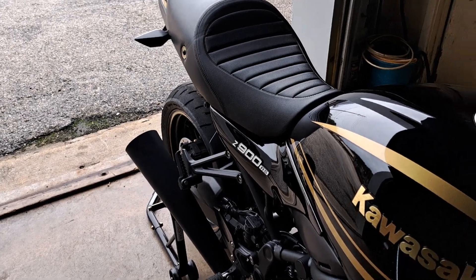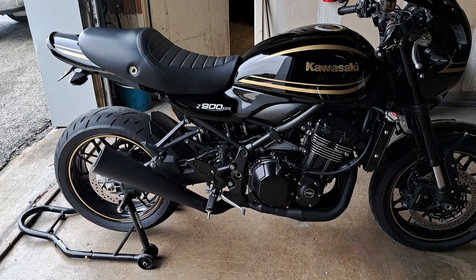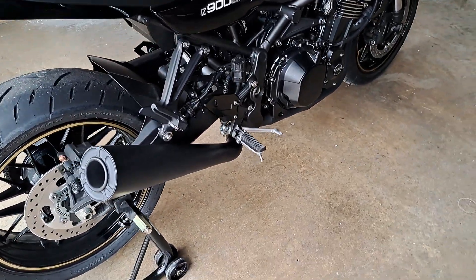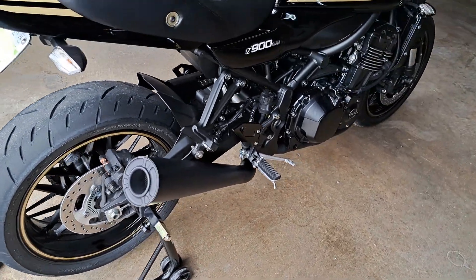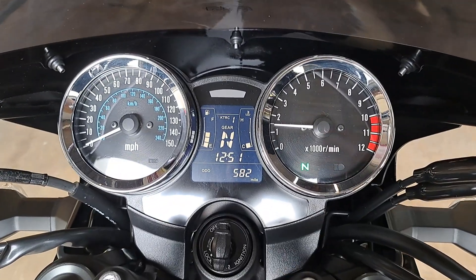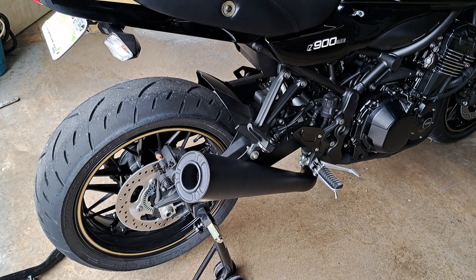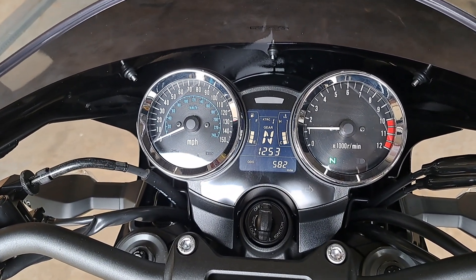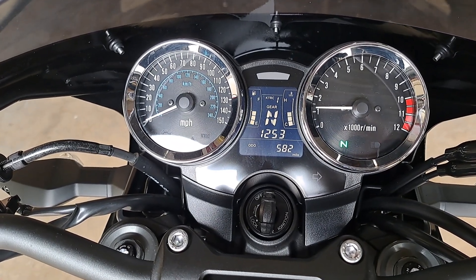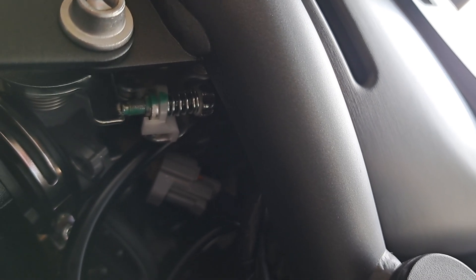She's going to go through cold start, a little bit of a high idle. We'll get her warmed up and I'll give you a couple of whips on that throttle. As she warms up, it'll start to step down and idle down to about 1,100 or 1,200 RPM. She's just settling down into an idle. If it does high idle or low idle, let me show you where you adjust that on one of these bikes — right there. You can screw it in or screw it out to adjust your idle — in case you didn't know, that's how you do it.